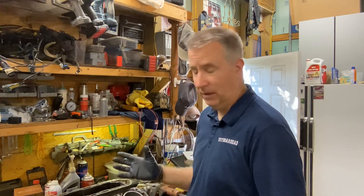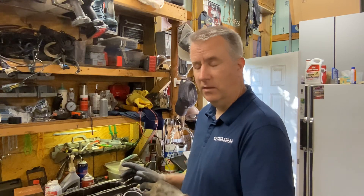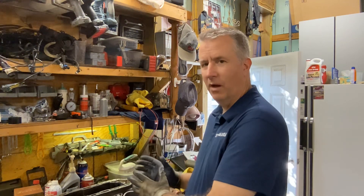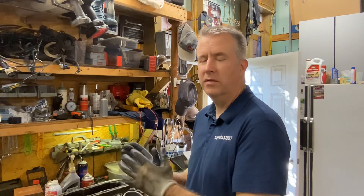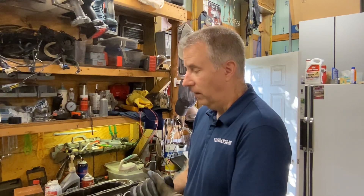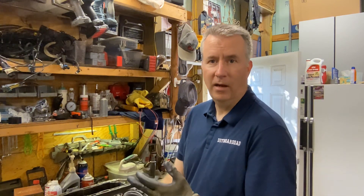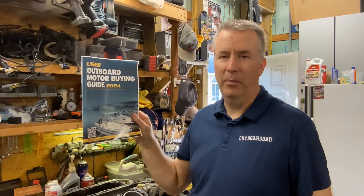Please like, subscribe, and send me any comments. Boring can be boring, so I'm not going to make you watch all of it. We're going to get to the point where we're getting close, guarantee we have the right sizes, and then go one cylinder at a time — finishing each one completely with the 200, 300, and ball hone before moving to the next. Stay tuned, thanks for watching. It's Keith McGowan, the Outboard Dad, here to help you have a better boating experience. Don't forget, there's an electronic copy — a $20 value, free — of my used outboard motor buying guide, covering all the tests you need to check when buying a better motor. Have a great day.